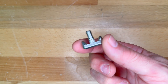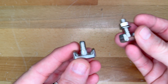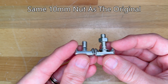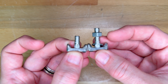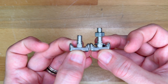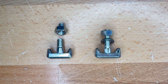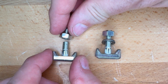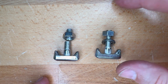Here's a close-up of the busted bolt for the terminal. As you can see, roughly around here is where it broke off. Here's the new one, which is identical in manufacturer using the same washer and the same nut at the end. It's quite a bit longer, and you need that length to fit through the terminal on the positive side. This is the first time I've personally broken one of these on a vehicle, so kind of a hassle — I had to order these on Amazon since I couldn't find them locally, and luckily had this delivered the next morning.